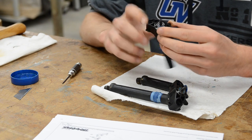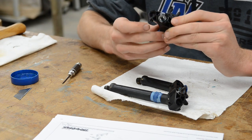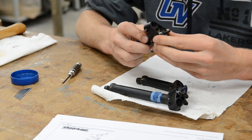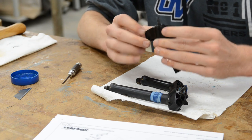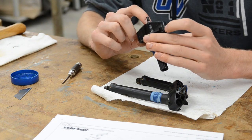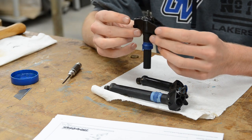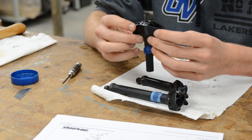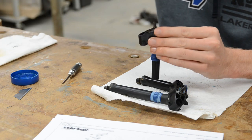These are seized into the bearings with rust, and unfortunately the outer part is what I want to keep. The bearings I won't be keeping because they're so rusty, but it just won't come apart. So I've sprayed a little bit of PB Blaster penetrating oil in here to hopefully break some of the connection. What I'm going to do is place this in a vise — not squeezing anything, just spread out so the drive shaft can pass down through — and carefully hit the end with a hammer.